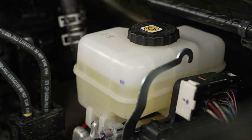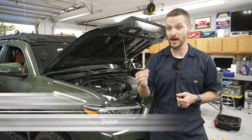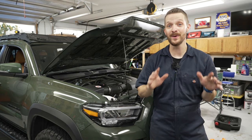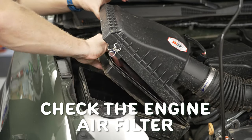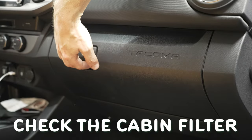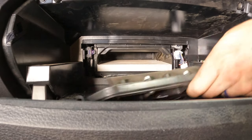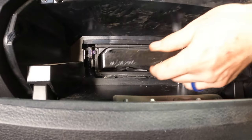Let's inspect some stuff in the engine bay. Make sure all your fluids are reading full — if they're a little low, like my coolant appeared to be, top them off to the full line. Checking your engine's air filter and cabin air filter are incredibly easy on this Toyota — please never pay someone to change these for you. For your engine's air filter, simply pop off the two latches and lift the top of the air box. My K&N filter is still in great shape — the cool thing about K&N or TRD air filters is you can clean them, re-oil them, and put them back into service. To check the cabin filter, open your glove box and pop straight up on the filter cover. I was shocked at how dirty my cabin filter was with only 5,000 miles, likely due to off-roading, so I opted for a serviceable K&N filter instead of stock.